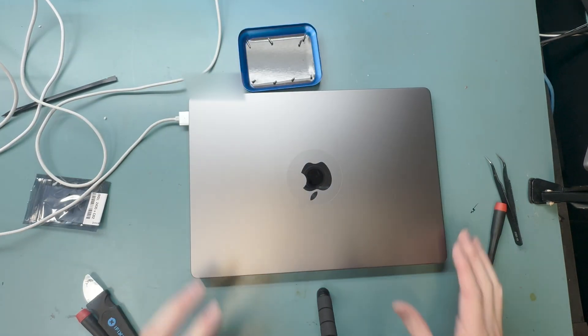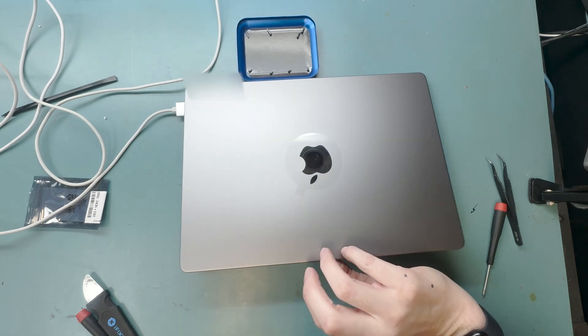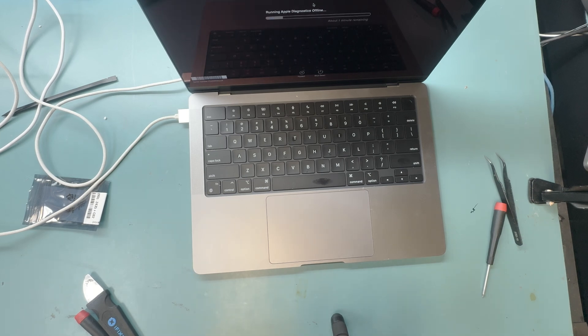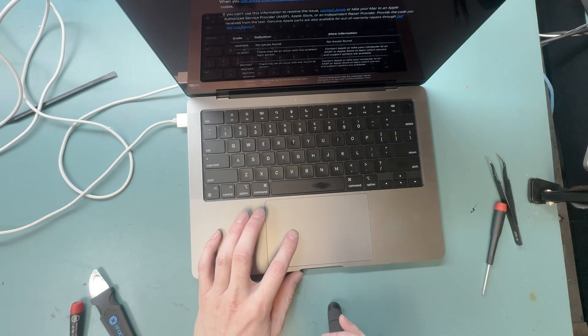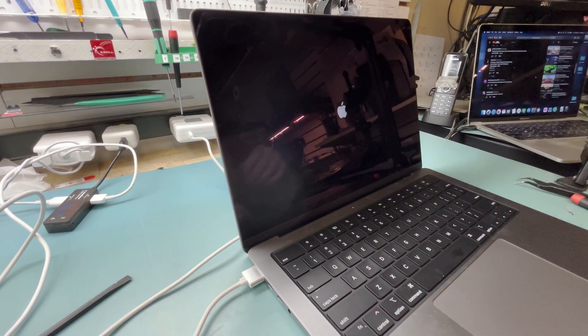It's very important that you don't just go through autopilot setup — read everything first. For example, shut the lid for 20 seconds then open it. I waited a little longer than 20 seconds and had to redo the diagnosis. You have to do the lid angle sensor step first, then program the screen. Replace the lid angle sensor — otherwise you'll have a screen artifact. Run it in offline mode and contact Apple's self-service support page if you run into any issues.